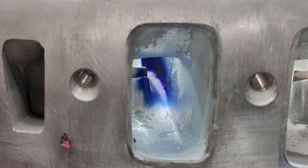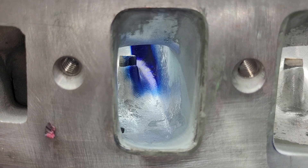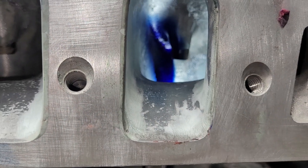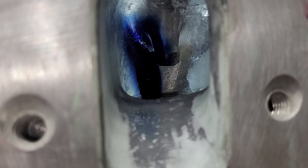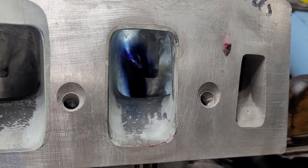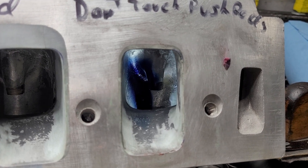Looking down its throat, it really doesn't look too bad. I like the way it hit in the bowl itself and on the guide quite a bit. When we go over airspeeds, it's really interesting how these are set up. We got just a little tiny bit of blue on that short side radius. Make sure you can see how tall that short side radius is — it's very tall. That short side measures 1.26 inches from the deck, and it absolutely needs a short side that high. In fact, it may need it a little higher than that.